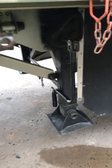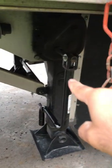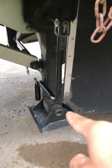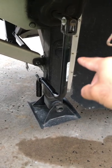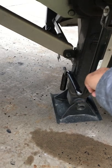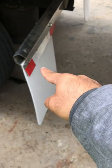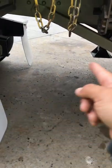Then you go over your landing gear. Landing gear, properly mounted and secure, not cracked or broken, and it's in the fully raised position. Crank arm, properly mounted and secure, not cracked or broken, and it's in the locked position. The clearance from the mud flap to the landing gear is good, it's clean, so that way it doesn't hit when turning.